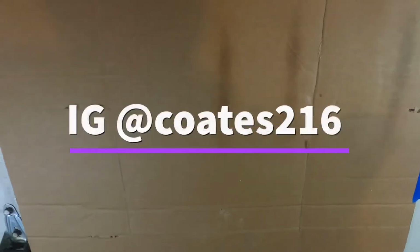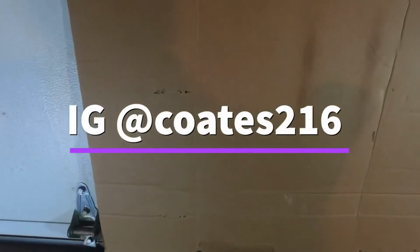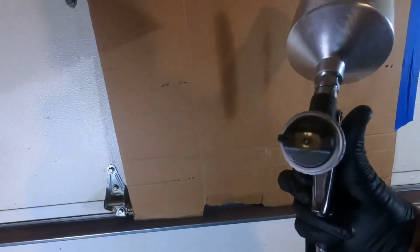But if you're a professional painter, or if you have experience with garage painting, I know Tony Oliver is another guy who's got plenty of experience with bad garage-built paint jobs. Hopefully somebody can chime in and give me an opinion on this spray pattern. Like I said, this is a 1.3 tip. This is just some spray gun cleaner, and like I said, it's 30 PSI.